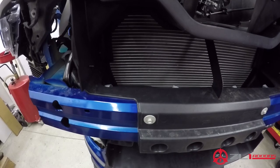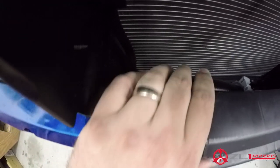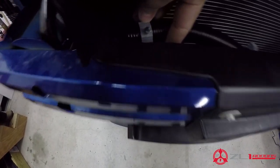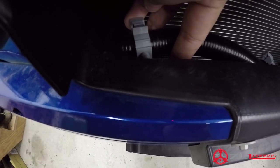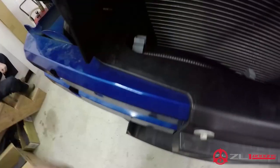After removing your whole front bumper, the first thing you want to do — there's going to be a couple clips along the backside. There's a nice big fat wire harness looped through here. There are a couple of clips right here — they are tree-style clips. You have to pull these out; you can use a screwdriver, a finishing tool, etc.